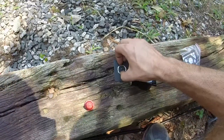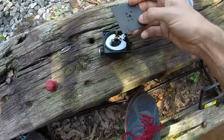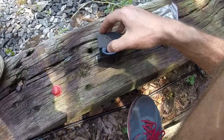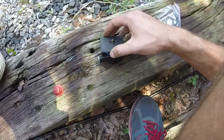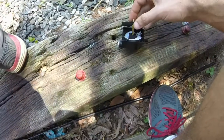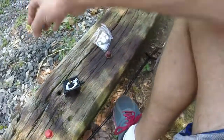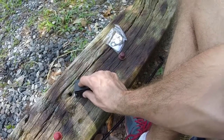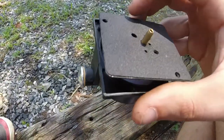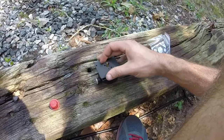We have to get the jet in there, which isn't too bad. You've got your little gasket that goes in between the top and the bottom of the carburetor — the top of the carburetor on these is fine, it's just a one-piece deal. I'll reference the old one to compare — you can see it sits above the little stop. It's probably just stiff because it's new, but that is the way it goes in there.